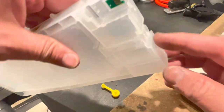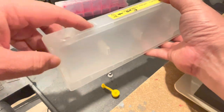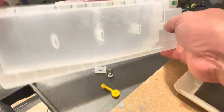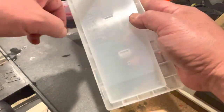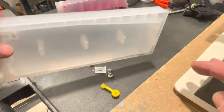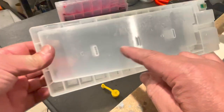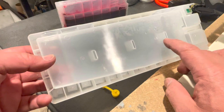Clean all those components because when you have ink in there, it'll be covered with ink. Once the front is clean and clear, go ahead and put water in here. Put a finger on top to close it off, swash it around, then drain it out — all the ink and water will come out. Do that until it's completely clean, then flick the cartridge around to get all the water out. Tilt it towards the back filler holes and leave it overnight to dry. It's not recommended to have water in the cartridge with ink, so try to get it as dry as possible — maybe blow some air in there.